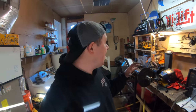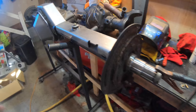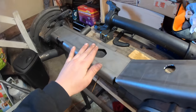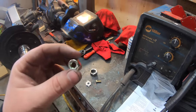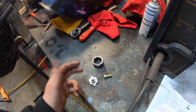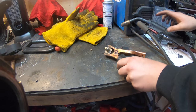After tacking down the truss, I let it cool for about 10 minutes and now it's time to start adding stuff to the truss. Everything is step by step with this Barnes kit — it comes with an instruction manual so you really can't mess up. The first thing I did was go ahead and weld on this coil spring bucket on the passenger side. I still have this side to go, but I wanted to get one side done first to show you some tips and tricks. These are the two side pieces and this is the top piece. First thing we're going to do is weld this nut onto here. It's a nyloc nut, so turn down the settings on your welder — you don't have to do a full weld, just a few tacks on each corner. I tightened the bolt and nut down just so it's not moving at all.